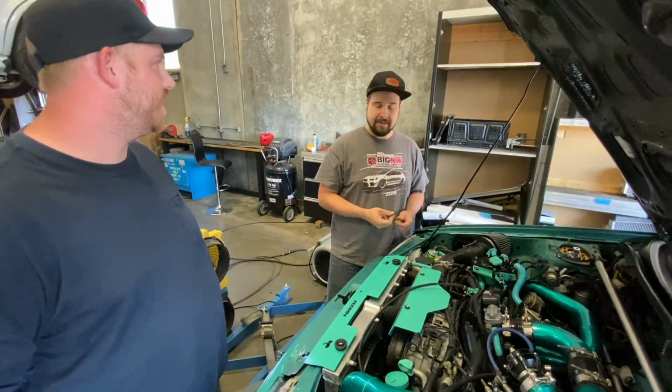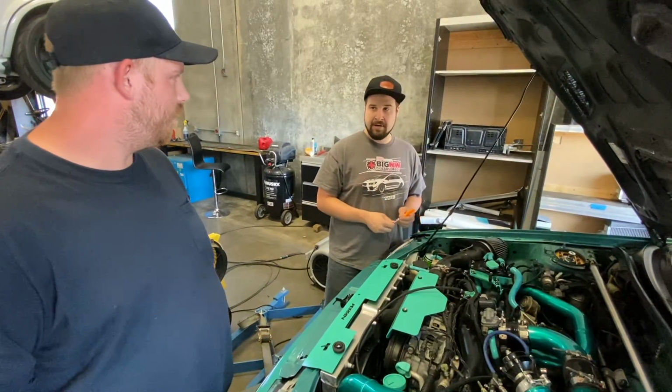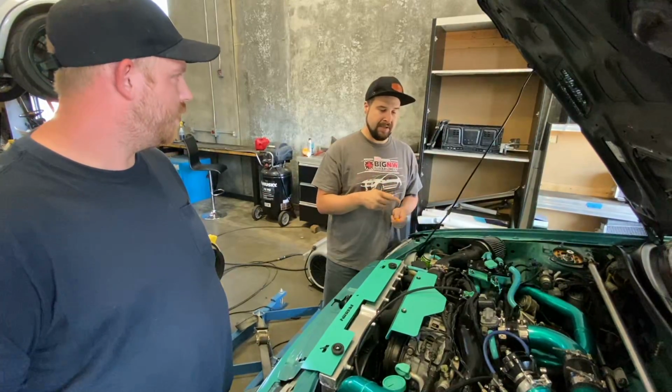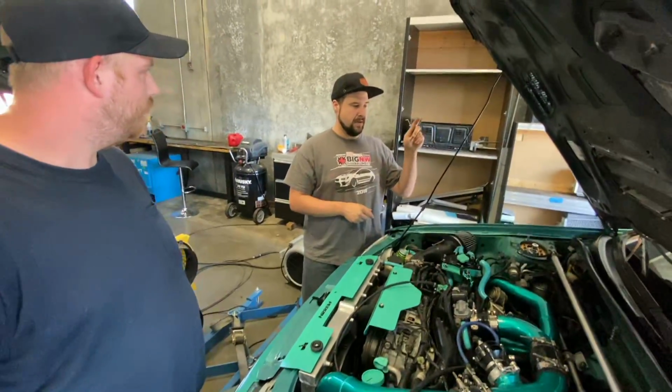Ignition power, basically. Yep. And make sure that it gets its power directly from the battery positive for the relay to supply the pump, and then ground it to the chassis in the back. It's really easy because there's a ground point right where the seat is.